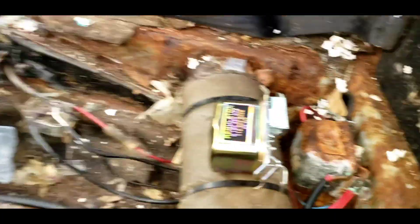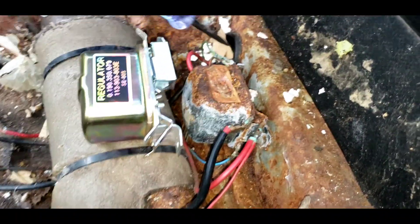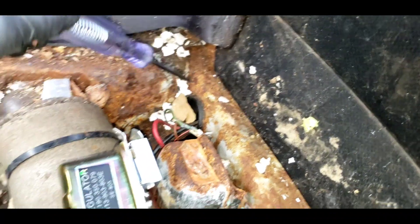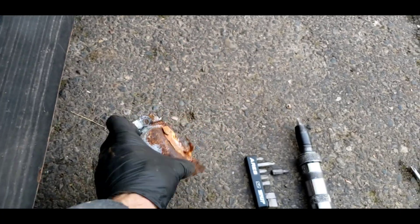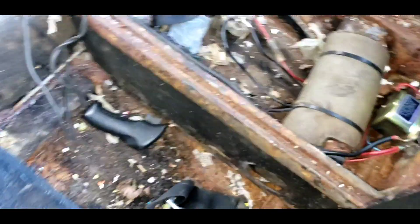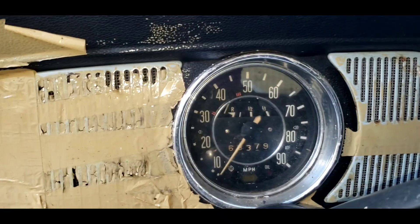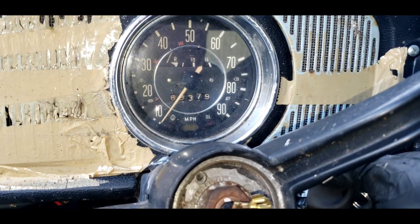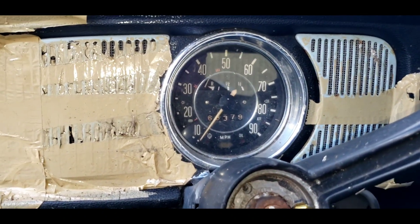Put a battery in our beetle bug. Wanted to make sure there's power to these wires — looks like there is, but I know it's not getting any further than that. I'm going to disconnect my power and take that out. So we got the old regulator out; it doesn't look too great. The new regulator's in. I don't know if we got dash lights yet — no dash lights. We do got crank. Now we just got to figure out how to get power to the coil.